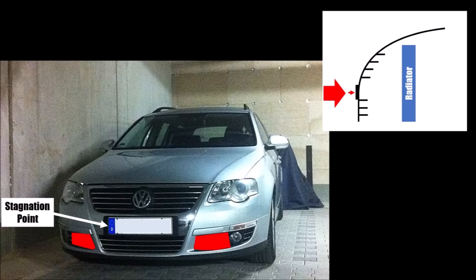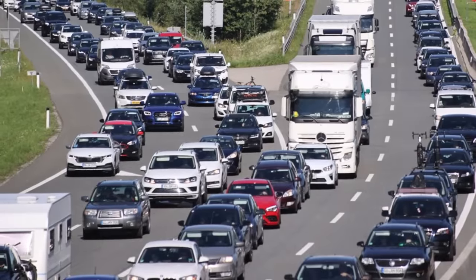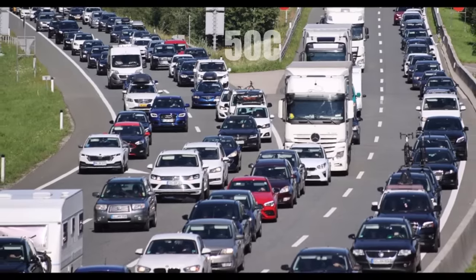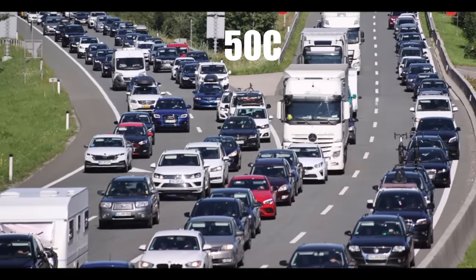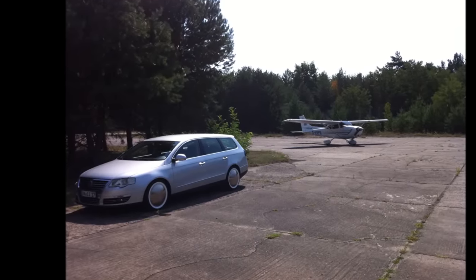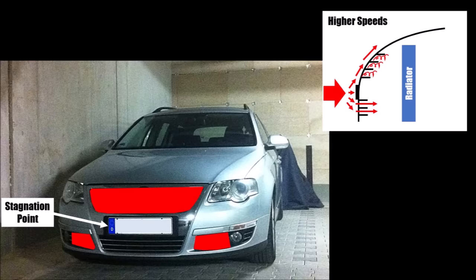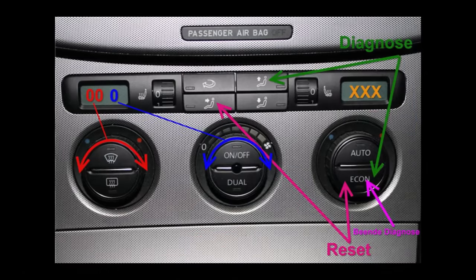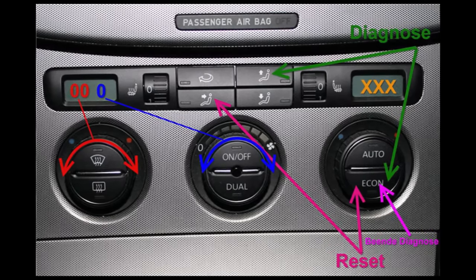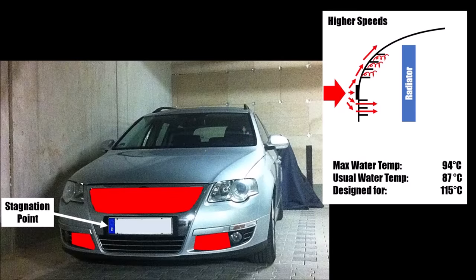The stagnation point of these cars is pretty much on the license plate. Since the front profile is fairly straight below, the main air intake is below the license plate. The profile above is swept back so no air enters the car there at highway speeds. The upper intake becomes important when the car is stationary, for example in a traffic jam, where the extreme test case is fans on full throttle and ambient temperature of 50°C — because you could stand behind a bus and suck in hot exhaust gas. Again, this extreme use case didn't apply to me, and if I ran into limitations, I would know why. So I closed the upper air intake from inside with a thin metal plate and sealed the edges with tape. To still monitor engine temperature, I used a button combination in the climate control of the VW Passat which showed me the real water temperature while driving, so even in hot weather I could monitor what was going on.